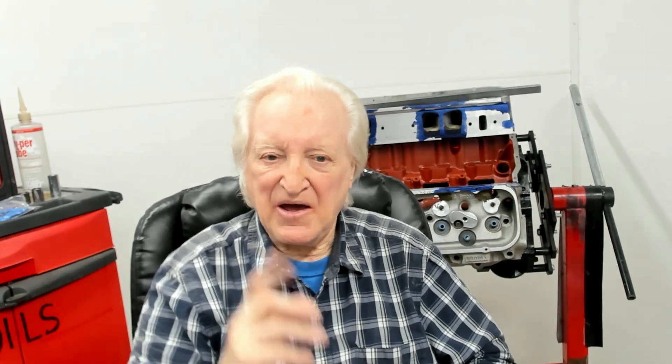With the four-and-a-half inch stroke, we got 525 cubic inches — quite a nice displacement size. I suspect that the bore-stroke ratio on this engine is fairly optimal. That's not to say a 540 wouldn't make more horsepower and torque, but it might not be quite as good in terms of foot pounds per cube. The increase in displacement would still pay off, though. So a 454 bored 60 over with a four-and-a-half inch stroke is a dynamite deal. If you've got a good 454 block already, you're home and dry — you do not need to fork out for one of those Dart blocks.